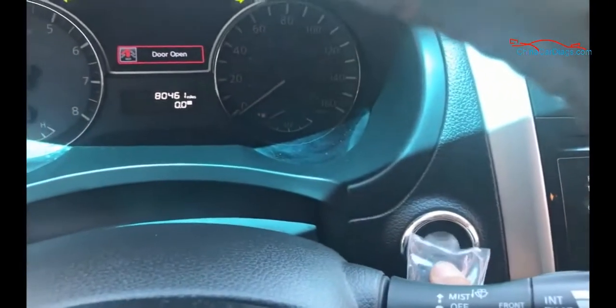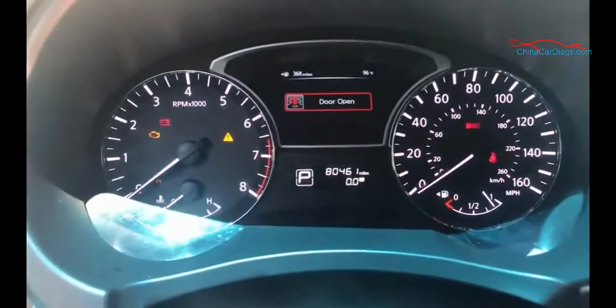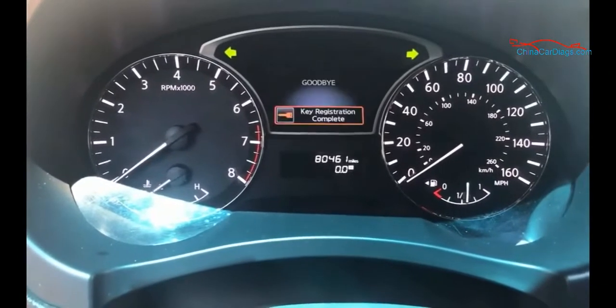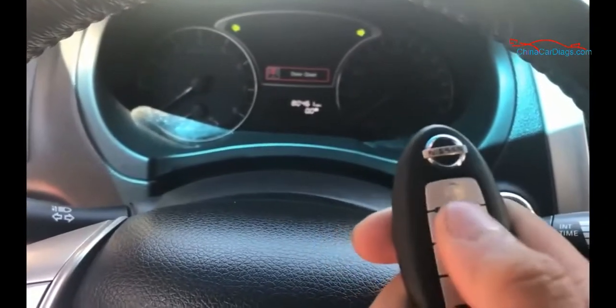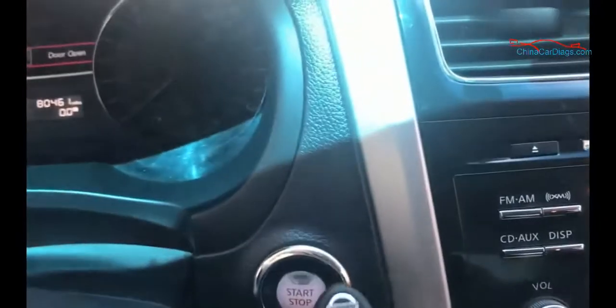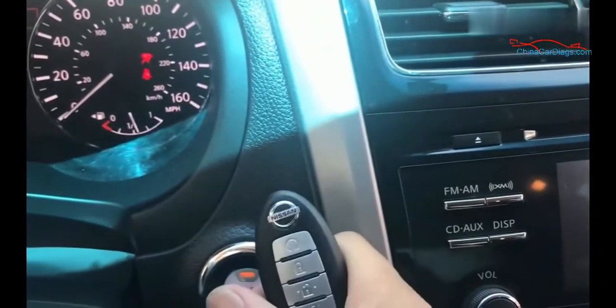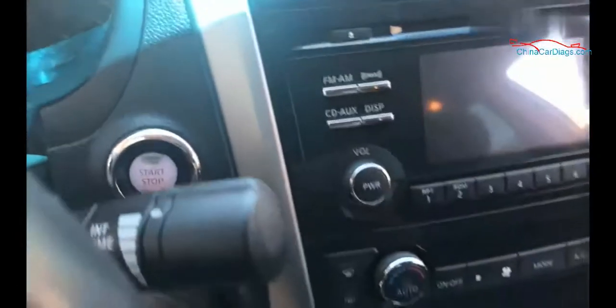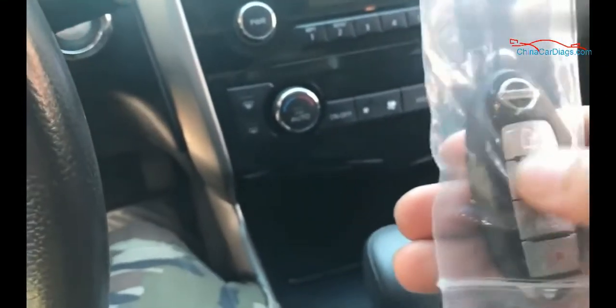Put it right next to it, press it — buzzer beep, it's complete. Press OK, turn off — key registration. Now this key is bad, so remember: sometimes the battery is bad or the smart key itself is bad. You can tell if it's bad — put the key right next to it and try to start it. If it works only when it's close, that means it could be the battery or the smart key itself. This one works, so of course if I start the car without it close, it starts. Also unlocking and locking to verify — it's all good.